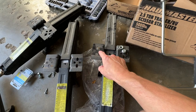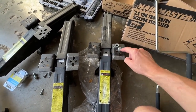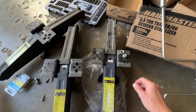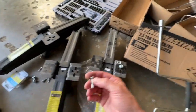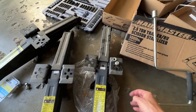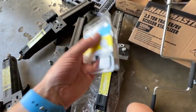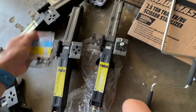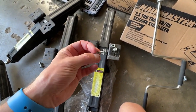These two here kind of go up into the I-beam portion of the frame, so those weren't used. This attaches to a little lip that's on the frame itself — that's why they attach there. So these were just attached with self-tapping screws. In replacing them, I also used self-tapping screws. I went and purchased some — these are number 14 by one inch, and they are the same as what I took off from the factory stabilizers.